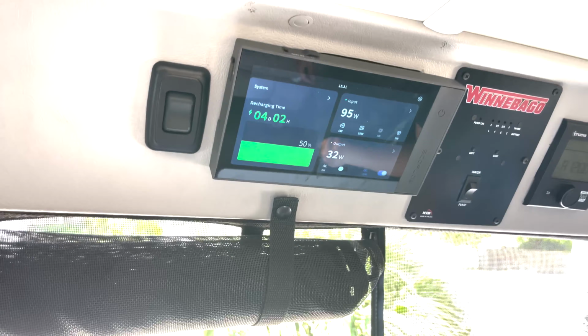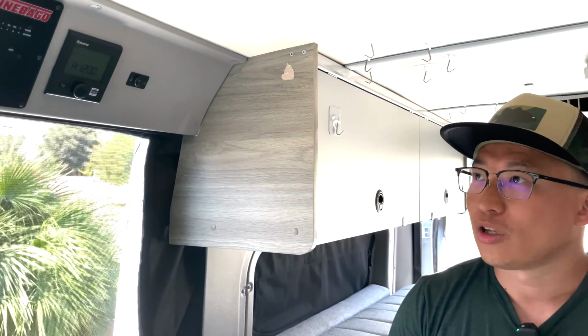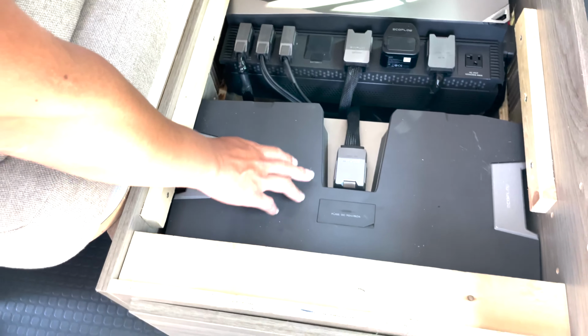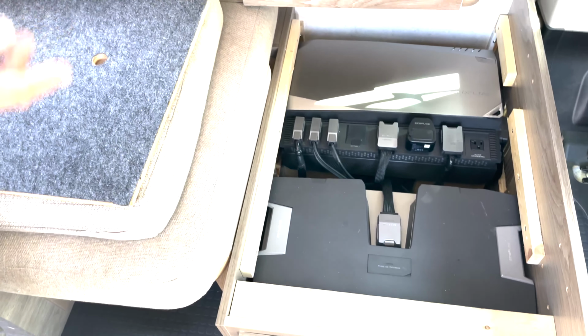Now, the total AC output power capability of this is how much watts? 3,600 watts for total, and 7,200 watts for surge. So you could run a microwave easily with this. That's cool. And the battery size is how many kilowatts? I see here fuse DC 70 volts 150. That's a 5 kilowatt hour battery, which is 51.2 volt at 100 amp hour.